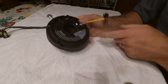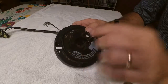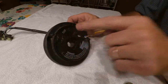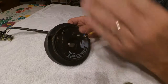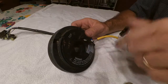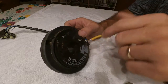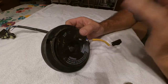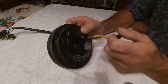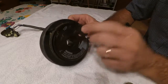When you put this in, you get a new one that's going to have a yellow plastic piece that holds it in place, because you want the top of the clock spring and the top of the center piece to be centered in its rotation, so that the wheel can turn the same amount of turns each way — two turns left, two turns right. Because if it goes further than that, it'll snap. That's why when you put this in, it's important to get it new with the yellow piece on the side so it'll hold this in place and when you put it in, it's perfectly centered.